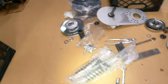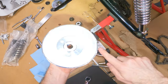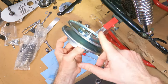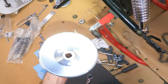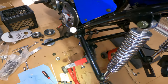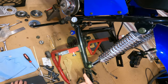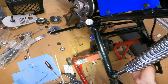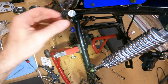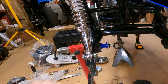Look at this — this is the guide that came with the stock bike, and look, it's all dug up. Some big chunks taken out of it, and that was with everything stock. That chain just flops around even when everything is stock and adjusted pretty well. You don't want to have it too tight when the suspension is down, because when the suspension goes up it gets way too tight and wrecks your bearings at the top and back here. That's another reason you want this — so the chain can be loose at the top without binding the suspension.